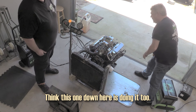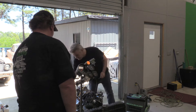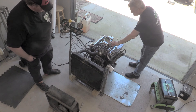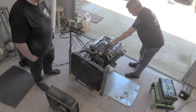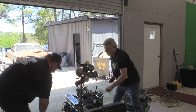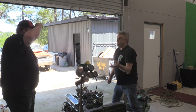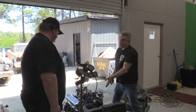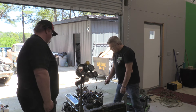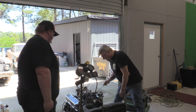It's got about 65 pounds of oil pressure. It sounds like it's idling real high. Let's shut it down for a second. We could probably back the timing off still just a little bit — 23 inches of vacuum I'm okay with, it dropped down to 21 at low idle, which is good. That means we're right about where we need to be on timing. Now we would know from a hot start if it labors whether we need to back timing out more. We've got plenty of oil pressure at idle, but we're shooting at the valve covers — still oil in the rockers.